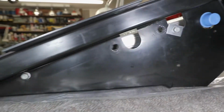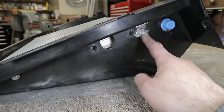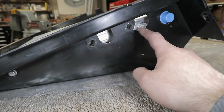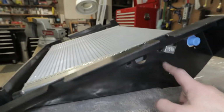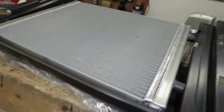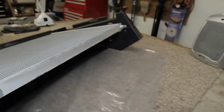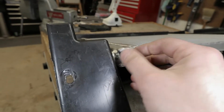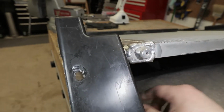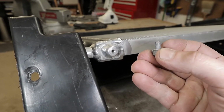As you can see there, this is what the other side looks like. Same deal. I used the stock 6mm bolts from my stock lid to make the hardware for this. I had to shorten the screws a little bit, about a 1/4 inch for all 6. And then on the end here, let's spin it around. I shortened these screws. This is for your oil cooler that gets mounted to the bottom. I shortened them to about a 1/2 inch long.